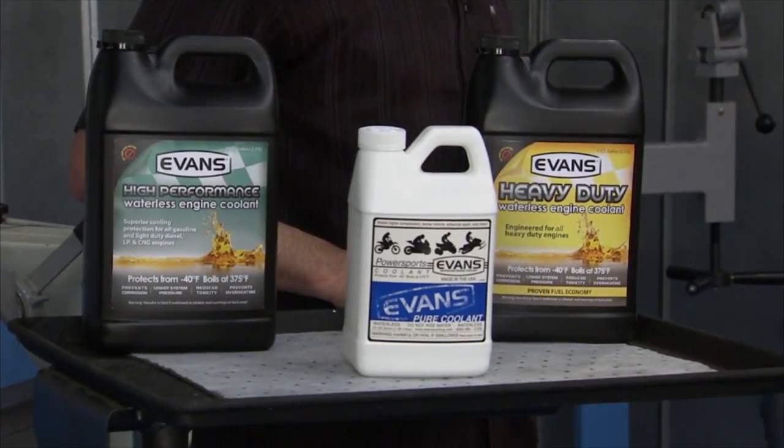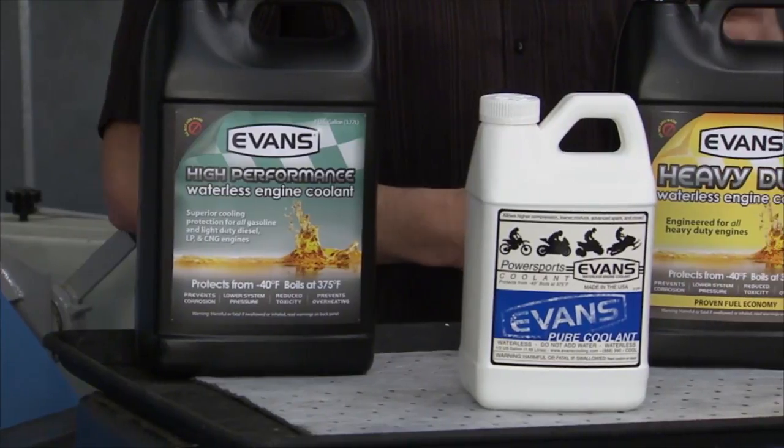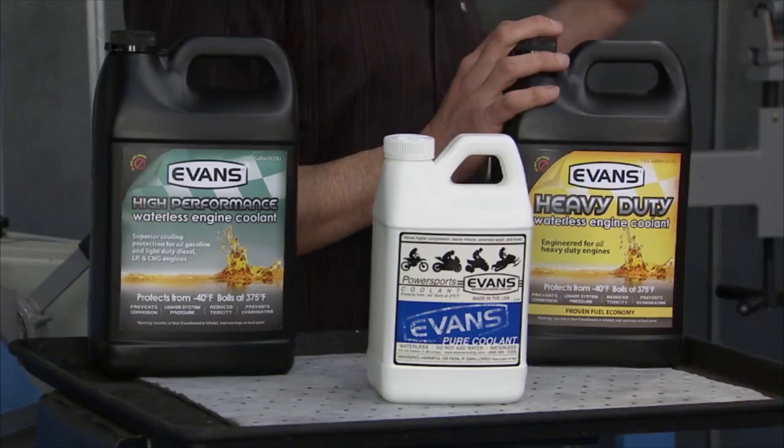One of the coolest tools you can have in any shop is a motocross bike. I used to do a lot of motocross riding out in Colorado and one of the things we were always battling is your bike overheating — same thing in race cars. This product from Evans is Evans Coolant — it's a non-water base, so there's no 50-50 mix anymore. Water is a great heat transfer device but it can also boil over, so when you're running to the extremes, your system can boil over. This will run up to 375 degrees before it boils. You can also get local hot spots where coolant flowing across a hot surface like a cylinder head near exhaust seats might boil up and create a steam pocket — an insulated bubble. You can't even get coolant to that area anymore, so local metal temp can skyrocket, warp the cylinder head. Evans Waterless Coolant is a great way to go out and hammer on stuff.